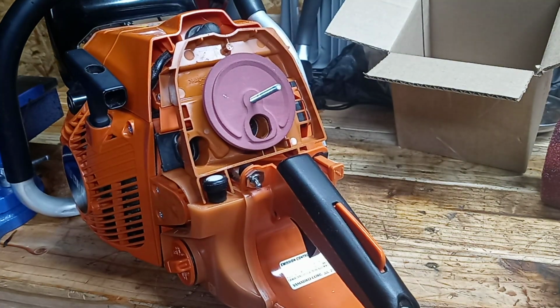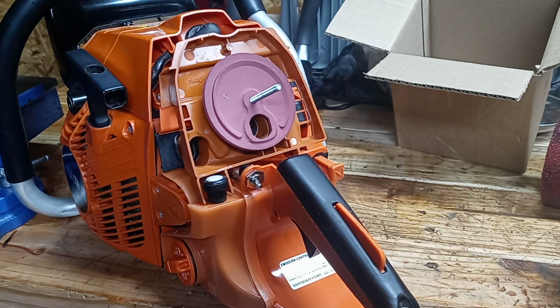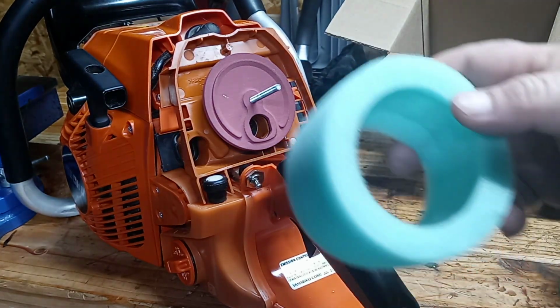And then this cage, let me pull this cage out of this filter. Give me a second here. I have not oiled this filter yet, and I'm going to discuss oiling foam filters too, since some people I've had to deal with in this chainsaw shack don't understand why you use foam filter oil, and no other oil should be used on a foam filter.